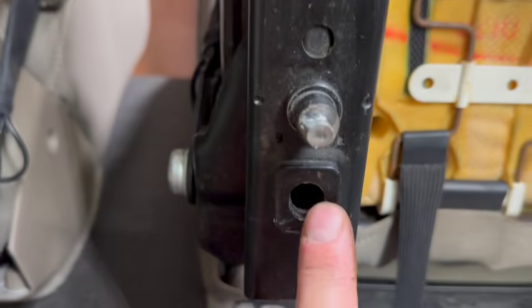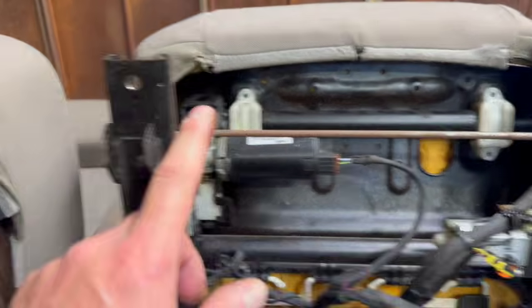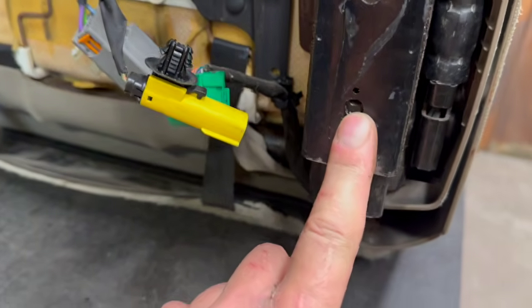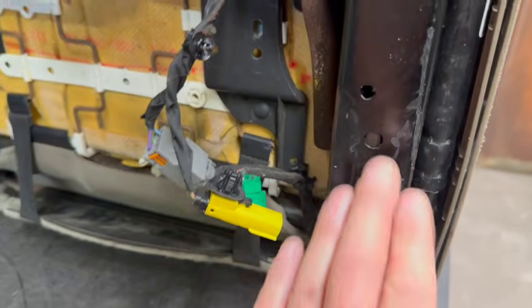And this hole right here was just left untouched. So basically the 2 top rivets I got rid of. And then normally I would just slice the bracket off here and drill out the 1 rivet, but I went ahead and just ground it down, gave it a coat of paint right there. And that's gonna give that side bracket a nice flush look.